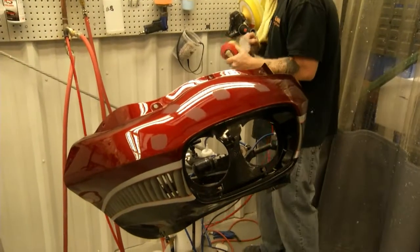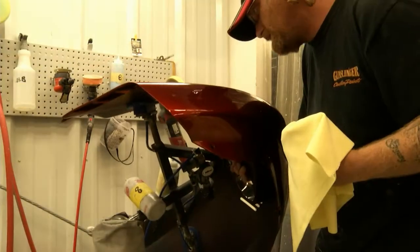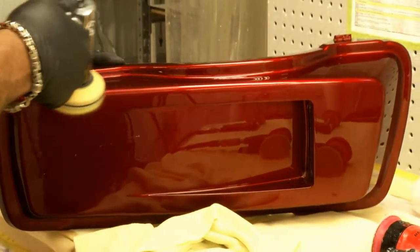One whole side of that bike is laid out by the art director. From there it goes on to the next steps — whether it's second or third colors, airbrushing, shadowing, or drop shadows — the art director is completely involved with all one-off custom work. There are added steps of clear coat, and then the polishing is done in a different manner: it's completely flat-sanded, re-cleared, and then polished. The entire bike is QC'd, all the pieces, and then it goes into a clear lockdown — a polyurethane high-solids clear built for wet-sanding. Then we polish the entire bike and it has that show-bike finish.